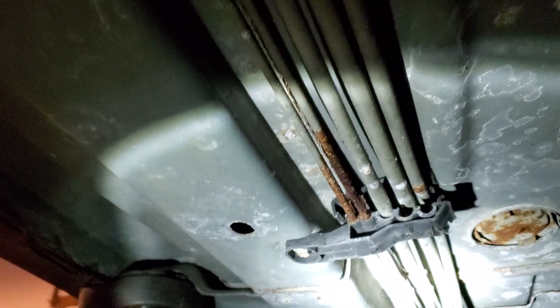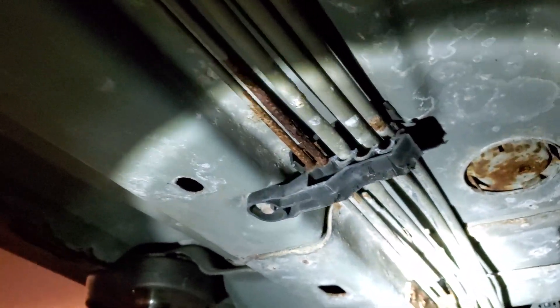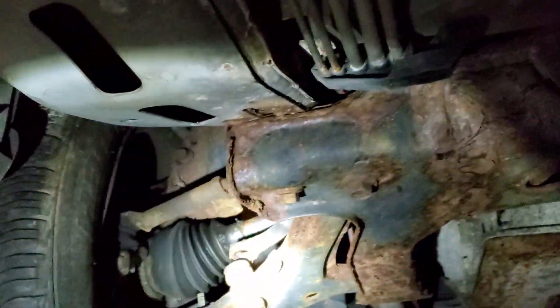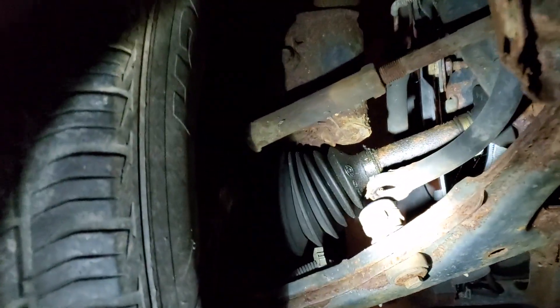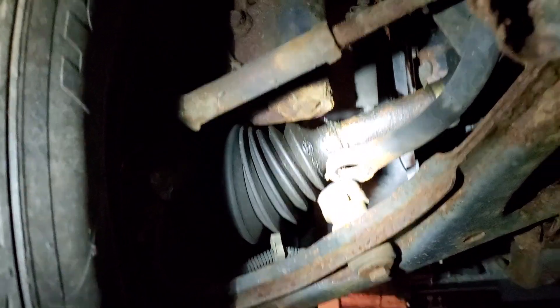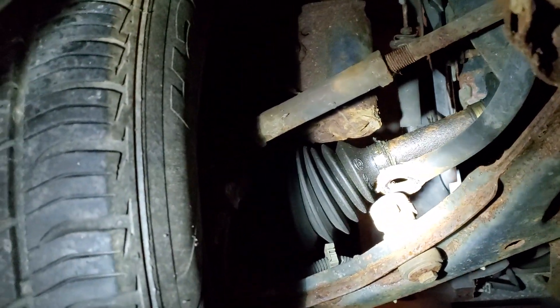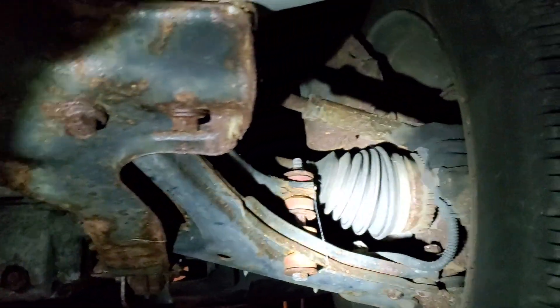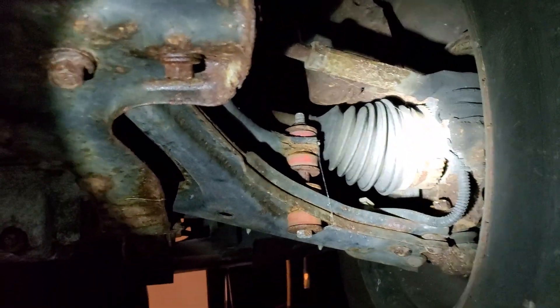You also have your emergency brake cable line that is rusting through, so you've actually lost both braking systems on this car. You can see where the sway bar linkage is snapped and the CV joint is leaking on this side. Anytime a customer says their brake lines have rusted through, there's always a lot more extensive damage underneath.